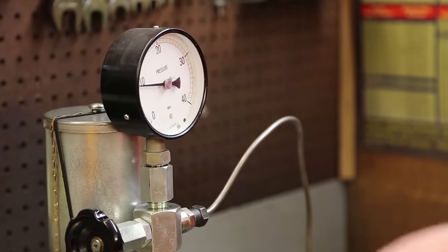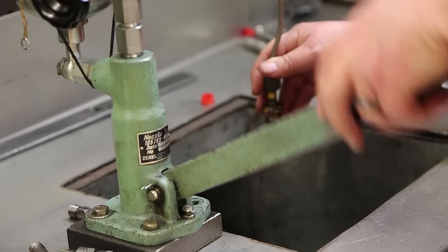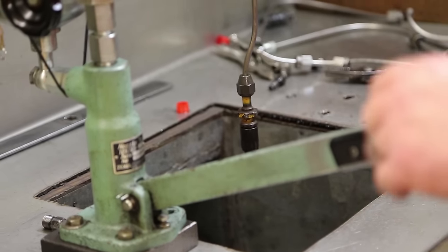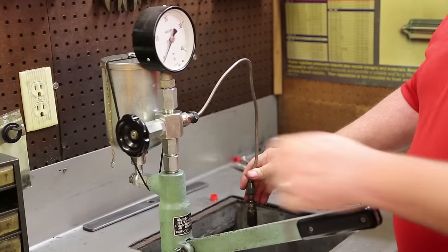Closer to where it should be. It's chattering good now. But this one would have been probably one of the ones from John's video where the spray pattern was less than desirable. Right there. Got just a little bit of leakage out of that seat. This will be number three going in.